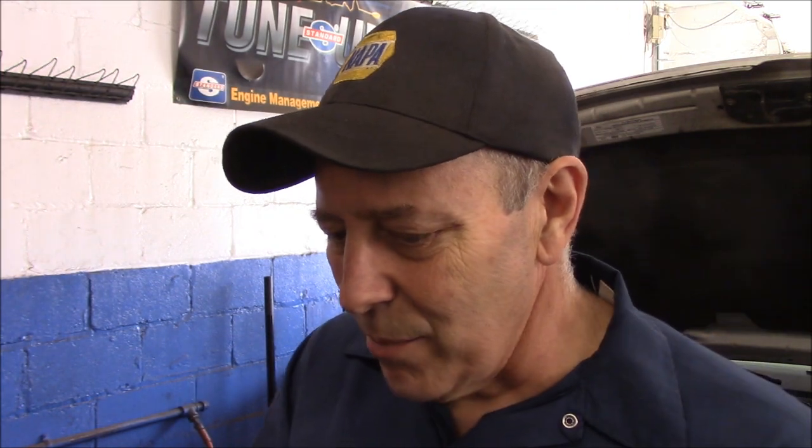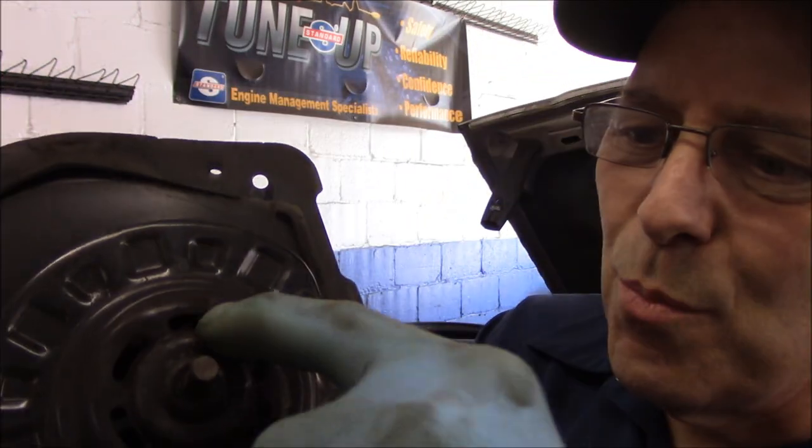That's the motor. And if you look very closely, you can see all this debris inside here. If you smell the motor, you'll smell a burnt smell, which is what happened — this motor burned out internally. So don't get ahead of yourself: check your power, check your ground, make sure that everything is okay. And that's it, you're all set.